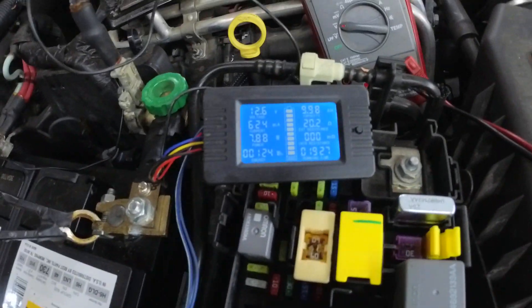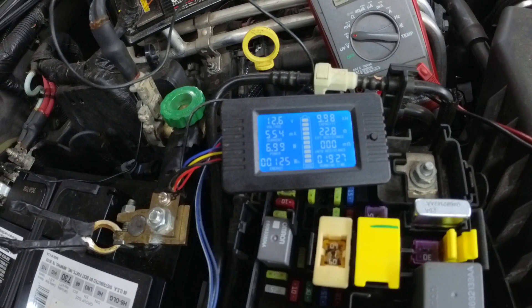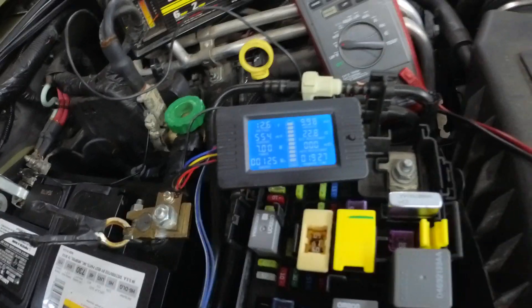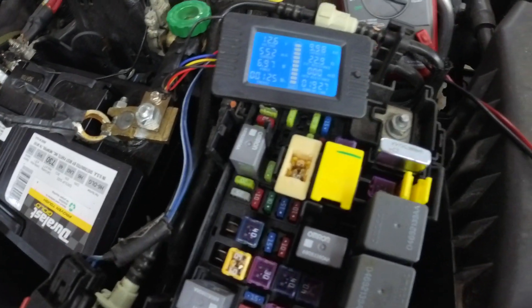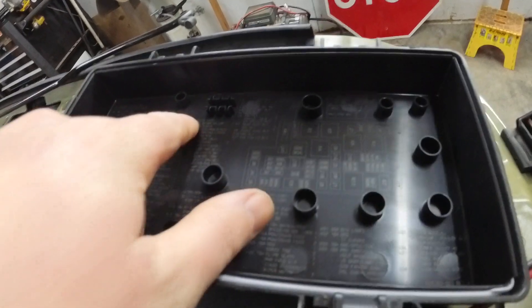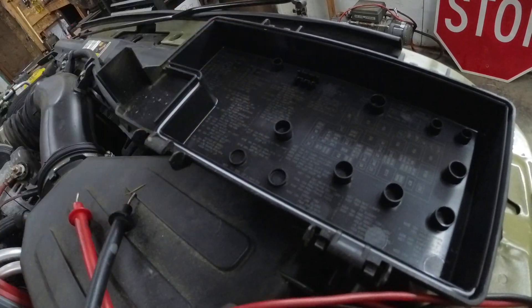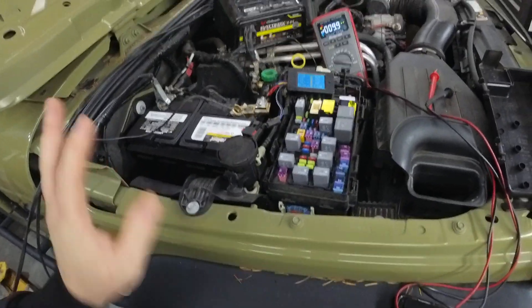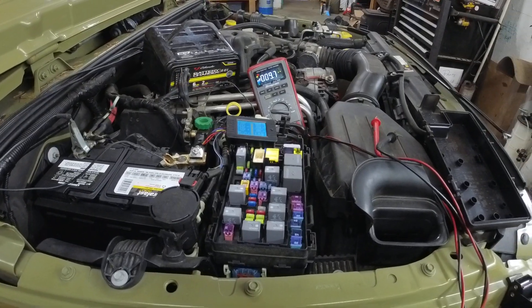You can see there's a broken mix door in there — it's running through its test and then going back to sleep. What we have is activity on this fuse — fuse M12 — which covers HVAC and amp/radio. Now what we need to do is go in and check for aftermarket accessories. I just wanted to show this voltage drop test to figure out which circuit is alive.